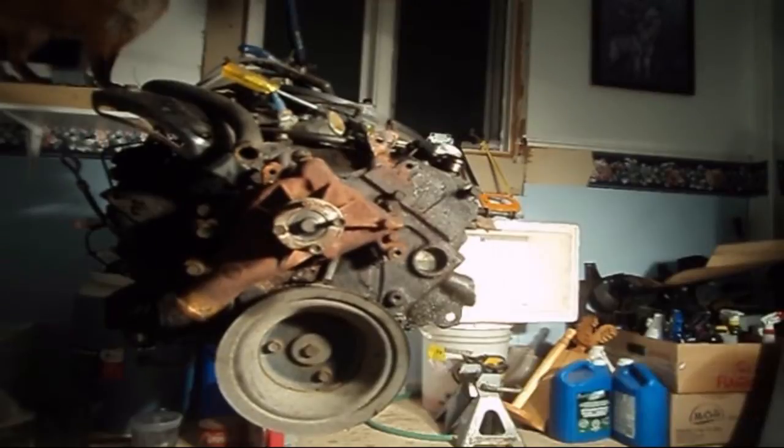Reinstall all necessary equipment — alternator, power steering pump if it had to be removed, air conditioner. There are a few fasteners and brackets that need to be loosened off if you do have AC. When you get into it, it's not that bad. It may look complicated if you've never done it before, but it's not a big deal. You will need to dedicate at least an hour and a half to two hours, and you may have to drain maybe half a liter of engine coolant from your radiator. Have some kitty litter handy, and also have containers to catch any fluid.